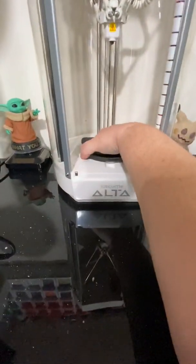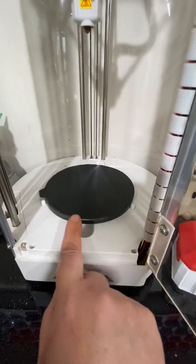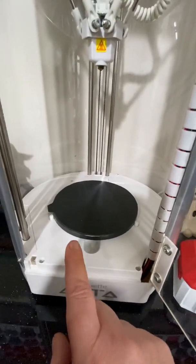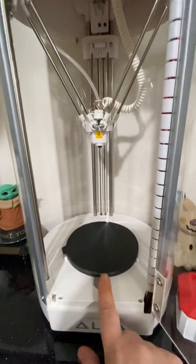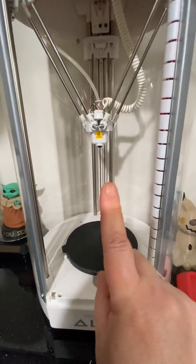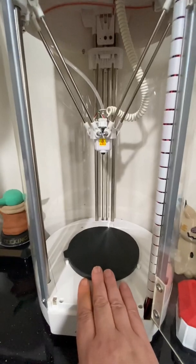Place it into your Alta, line that back notch up, and it snaps down into place. Make sure there's no overhang on the front edge so you can still extrude that first section of filament down into the hole. Once this is done you'll need to recalibrate your nozzle. Before calibrating, make sure you raise the screws up, because you've added height and you don't want the nozzle to dig into the surface and get damaged. Tighten and raise them up so you're starting fresh with the calibration process.